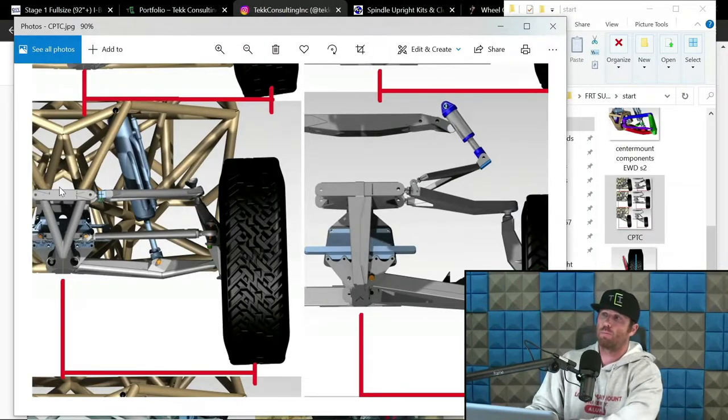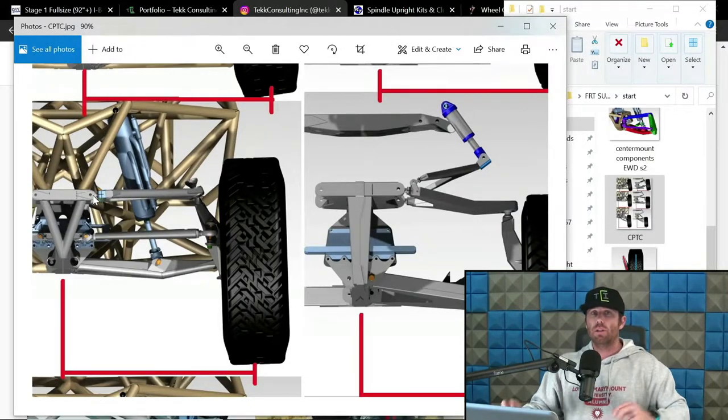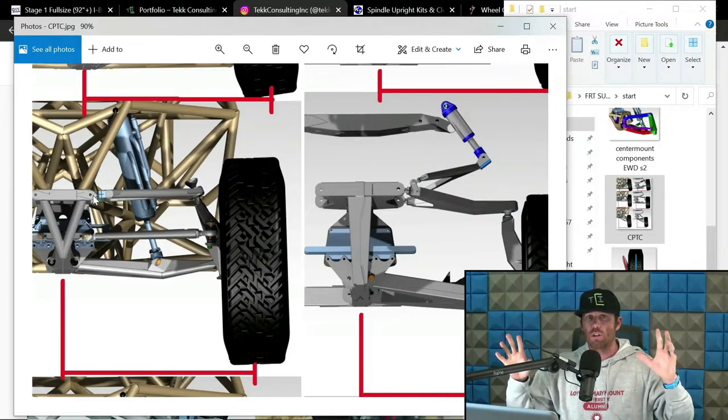So in other words, the spread of these right here is always going to be more than the spread of these right here. If they're not, you're probably going to have a bad day, or you'll see that through the cycle pretty quickly. But the point being is go 5 degrees down and kind of draw a line there. And then take this arm, whatever angle you have this point to this point, and you have like a 90-degree line coming up, add 5 degrees to that. And where those two lines intersect, so you have like a line coming here and a line coming down, pop the point there. This is like a good way to start by hand, so to speak, of like a reference.